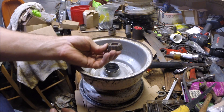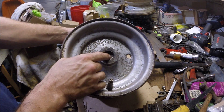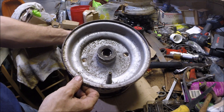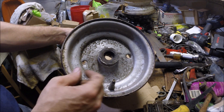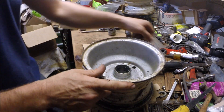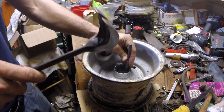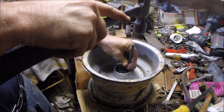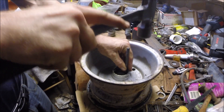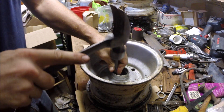Inside there's another tapered roller bearing facing the other direction, but it's trapped inside by a seal. To get that out, you just hammer on the bearing itself with a punch to punch that seal out. If you're just replacing the seal, you pop it back in, install your new seal, and put it back to work. So the first thing is to knock that seal out of the backside with a punch, hitting directly on the tapered roller bearing. It's a bit sketchy, but it does work eventually.